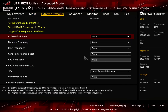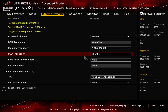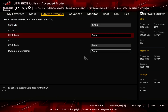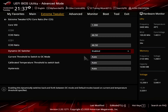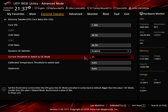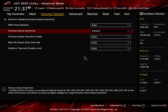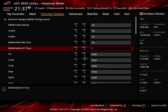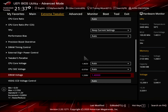For the maximum all-core manual OC with DOS: in the BIOS Extreme Tweaker menu, set AI Overclock Tuner to Manual, memory frequency to DDR4-3600, F-clock to 1800 MHz. Enter the CPU Core Ratio per CCX submenu: set Core VID to 1.3, CCD0 CCX0 ratio to 46.50, and CCD1 CCX0 ratio to 46.50. Enable Dynamic OC Switcher and set current threshold to 75 amps. Enable Precision Boost Overdrive. Set DRAM timings to 16-16-16-16-36, DRAM voltage to 1.4V, then save and exit.